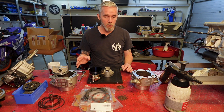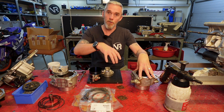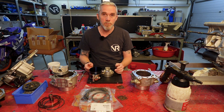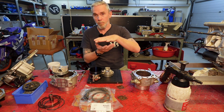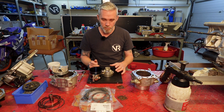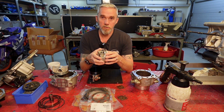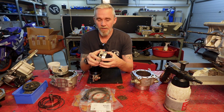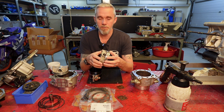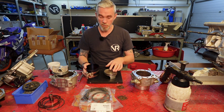First things first, let's get the piston in the cylinder. Because Ducati engines are designed in such a way where the cylinders are separate, you can actually put the pistons in the cylinder and put the cylinder back onto the block. Whereas with a Japanese four-stroke, generally the head and block are in one piece and you'd have to put the pistons up through from underneath and then connect them to the conrod. So we do have a bit of advantage, but it does mean you're putting the pistons in backwards. With the three rings, they compress into the cylinder and there's quite a lot of stick out - so it's a lot of compression that has to happen. You can do this with your fingers but it's not easy and it's got a lot of risks.